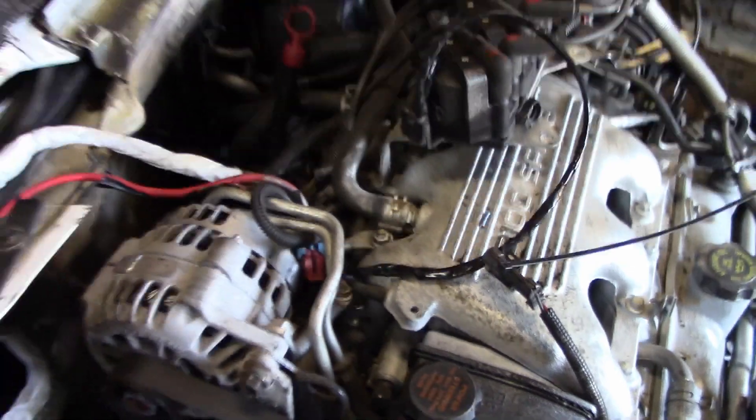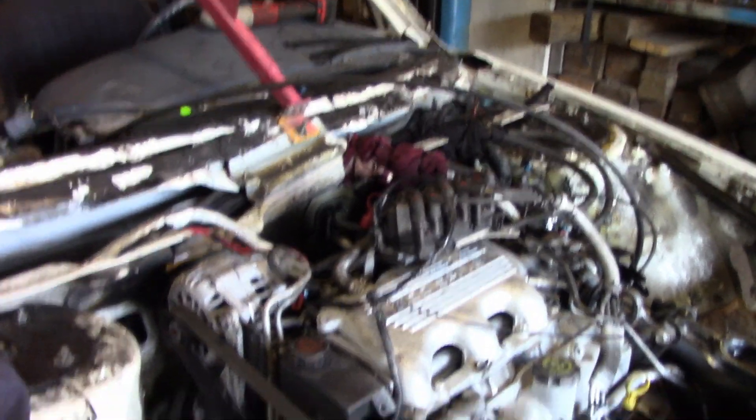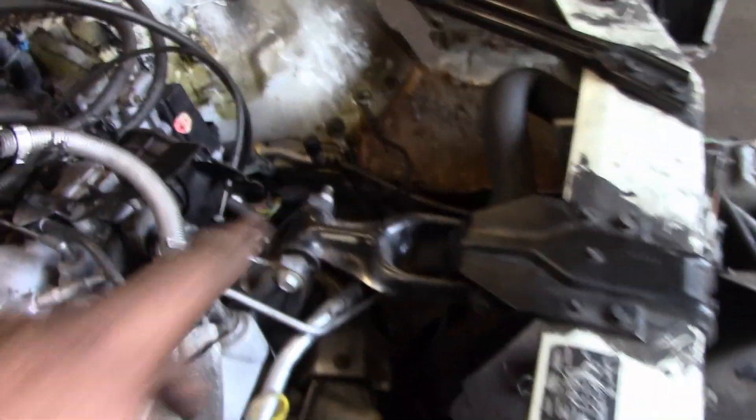I was told that this is a '95 - '95s are much, much harder to move the wiring harnesses. I actually had to lengthen about 12 wires in this by almost four feet, because they went from here to here and now they go from here all the way around in that harness, up and through and down.